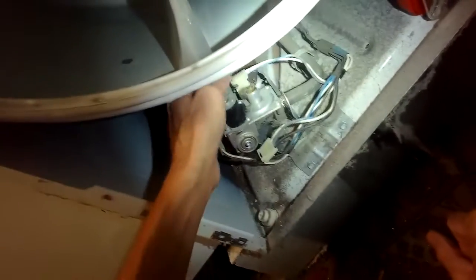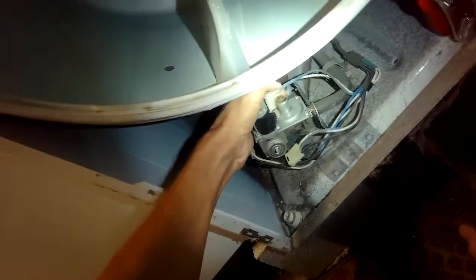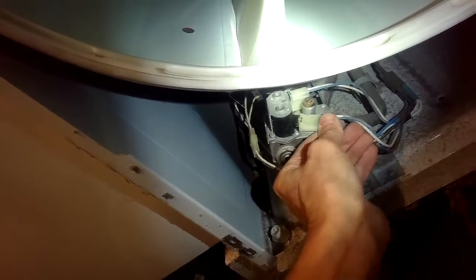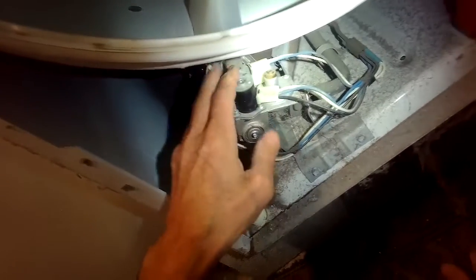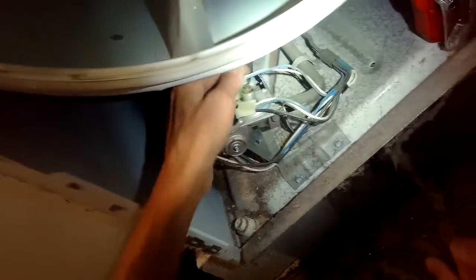The reason I ruled that out, though, is when I felt the volume of air coming out, it was very strong. It felt like a hairdryer. So I knew the vent tube was not obstructed, and that makes me think then gas coils are just getting worn out. So we just got the new ones in, primary and secondary gas coils. We've got the power back on. We're just going to put the pieces back together and test it out.